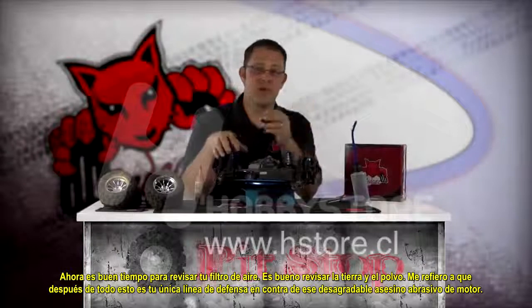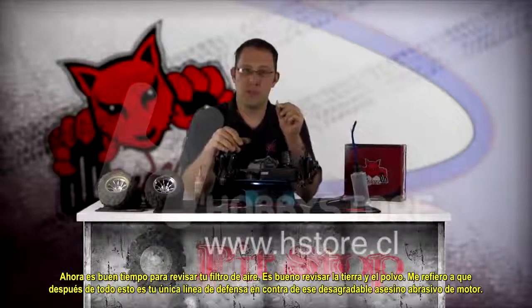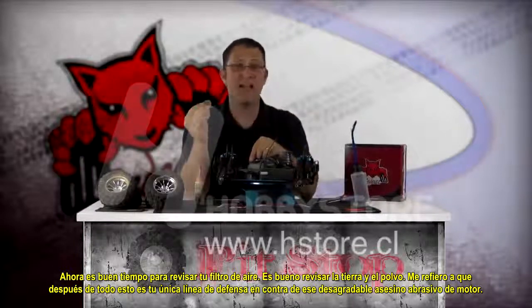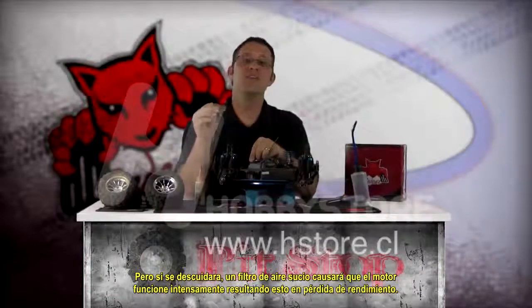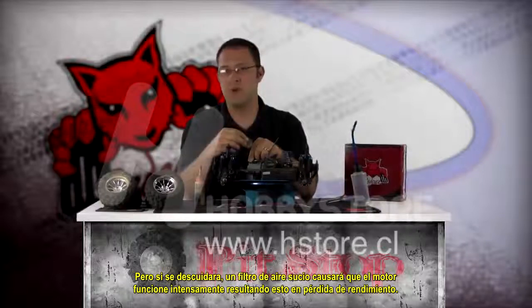Now's a good time to check your air filter. Dust and dirt build up on the filter elements, which is a good thing. I mean, after all, this is your only line of defense against that nasty engine-killing grit. But if left unattended, a dirty air filter will cause the engine to run rich, resulting in lost performance.